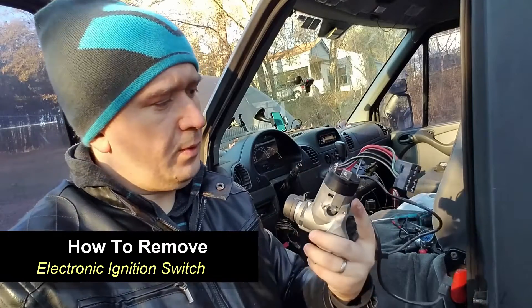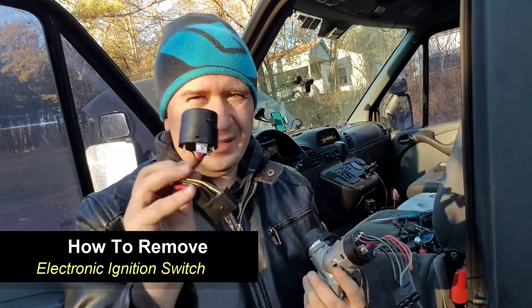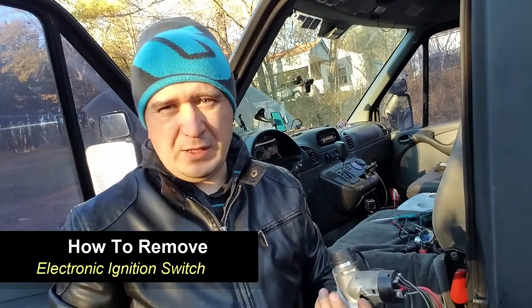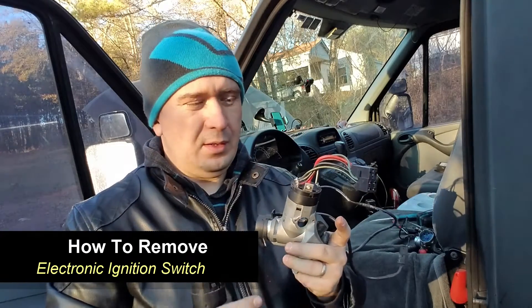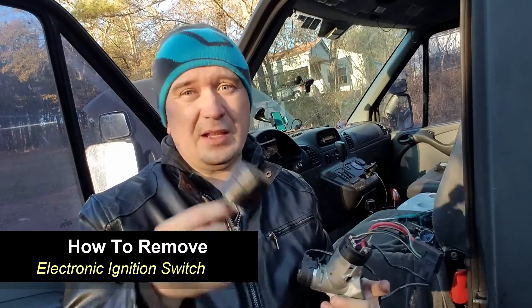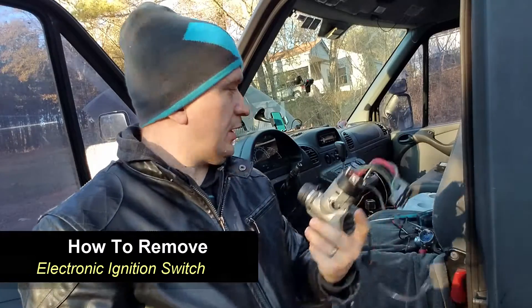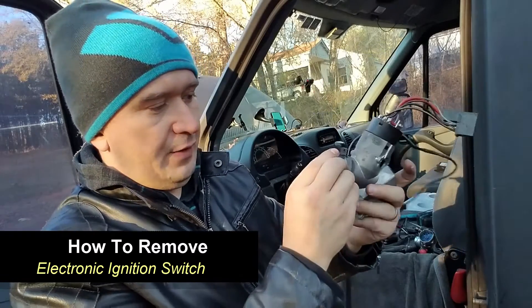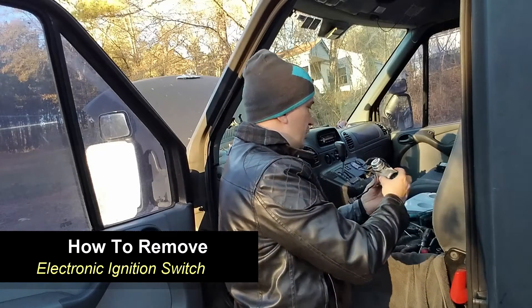I'm going to leave this one in there — I'm not being lazy. But let's say the problem is actually in this little thing: it's going to throw me off because I'll think I probably haven't fixed anything. Or if I leave this one in here and the problem goes away, and later I pop the brand new one in and the problem comes back — then I'll immediately know it's this thing. I want to rule out that possibility, so we'll leave this one in there. I'll keep the new one as a spare. It does have a bit of shakiness to the metal piece — seems about the same amount as the other.